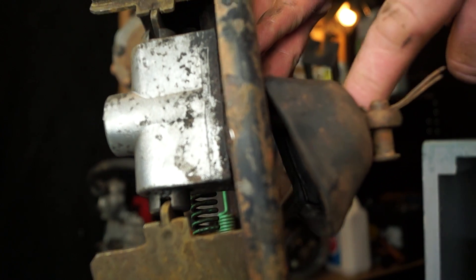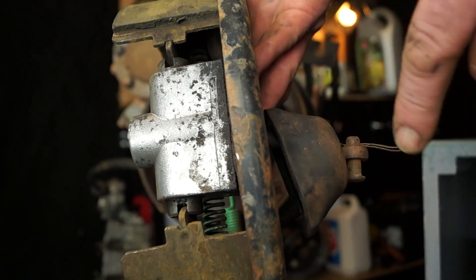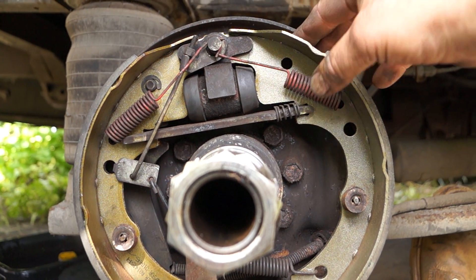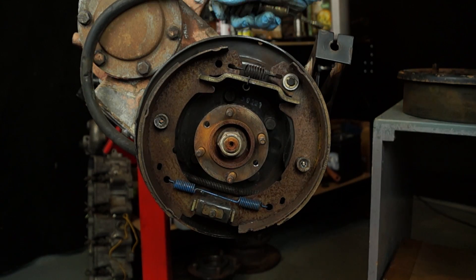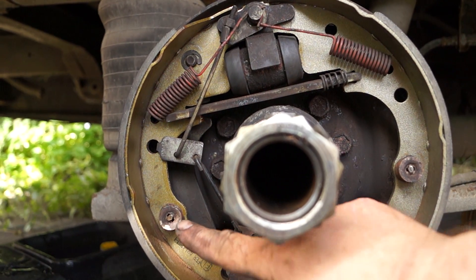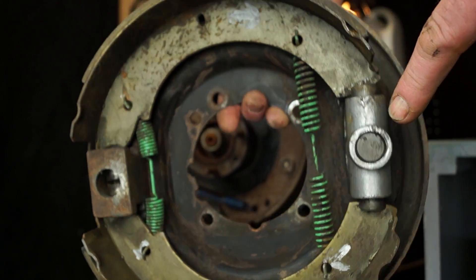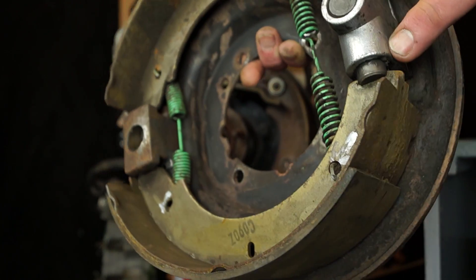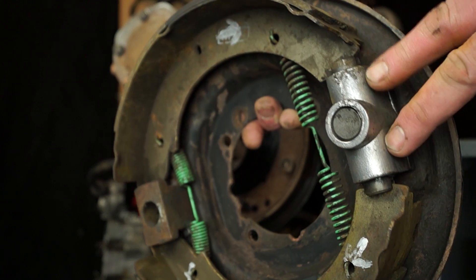Whereas this is more like a wheel cylinder the way it's pulled out and expands — you can see the wheel cylinder here. Our vertical shoes will have exactly the same retainers as these brake shoes, which are these two here. Whereas our horizontal set rely on the springs at the back of the shoes and slots in the expander and the adjuster to hold them into place.